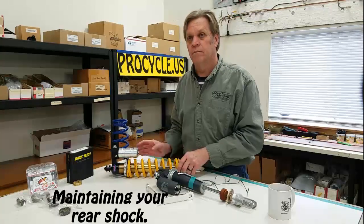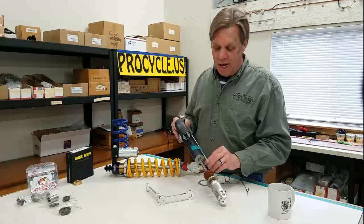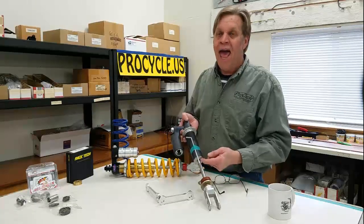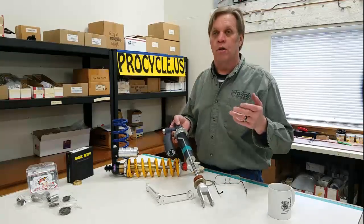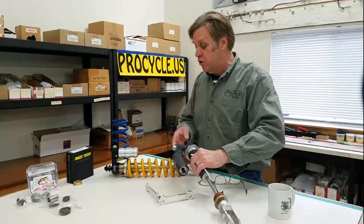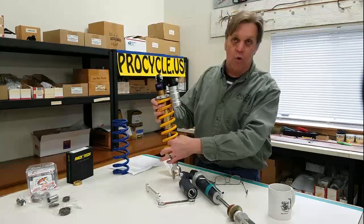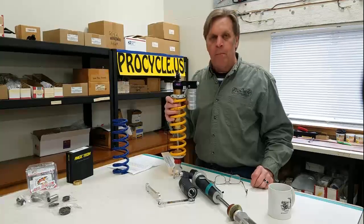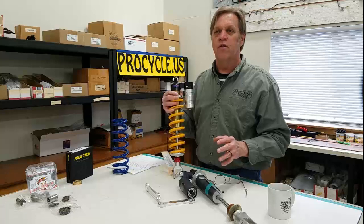Is there more regular maintenance you'd like to see more riders perform on rear shocks? One of the key things is to keep that shaft clean. Grit and grime get slung up by the rear wheel, and as the shock compresses up and down, fine particles can get caught up behind the seal and destroy it — causing it to leak. Don't take the pressure washer to the shock at the car wash; that pressure will blow right through the seal. The best approach is to just use some Windex or WD-40, soak it down, let the grime run to the bottom, and then wipe it with a towel. You don't have to do this daily, but after a big weekend ride take a look at it — if you see a little film or grime on the shaft, clean it off. That'll save you from having to take it apart.